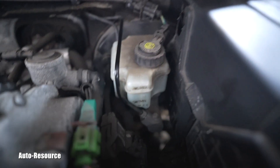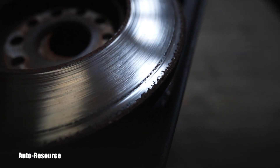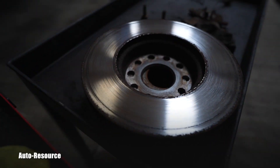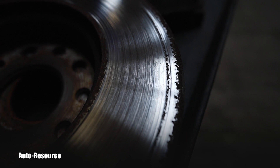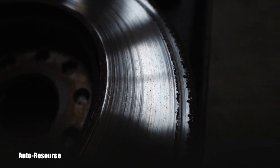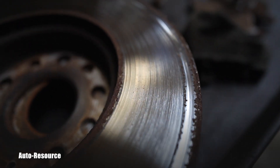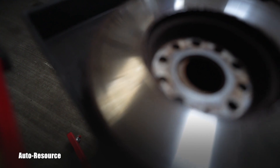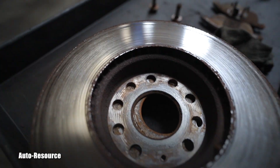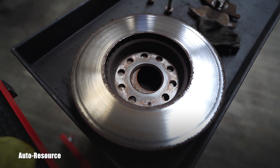I removed the engine cover on this 2009 Jetta. After pressing the driver side piston in, I can do the same on the passenger side without evacuating any fluid, because I can see nobody topped off this reservoir — I'm still between minimum and maximum. I also removed the passenger side wheel and look at the back side of the rotor, which is normally hidden because of the dust plate. Look how bad that rotor is on the back side — total scoring and rust.